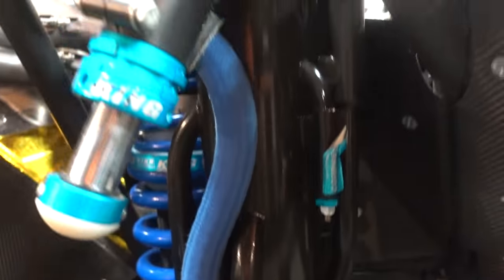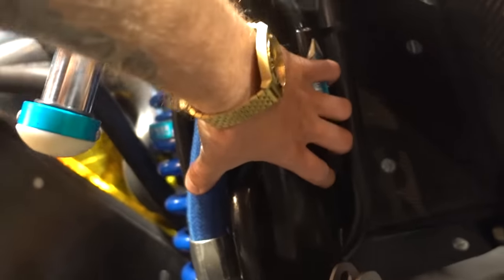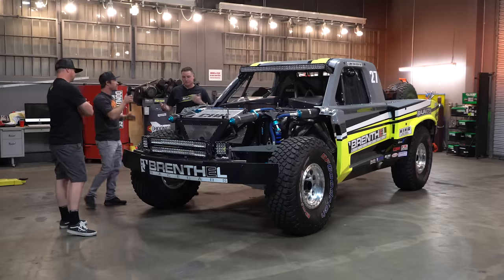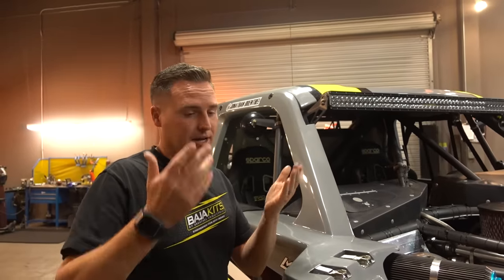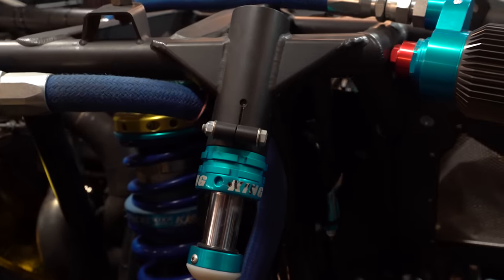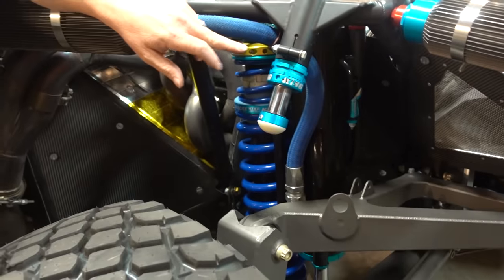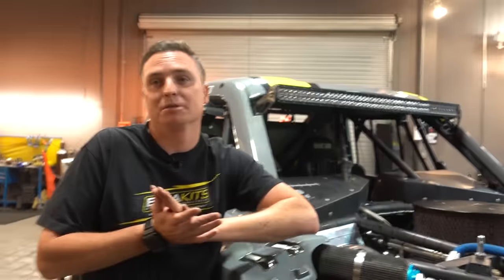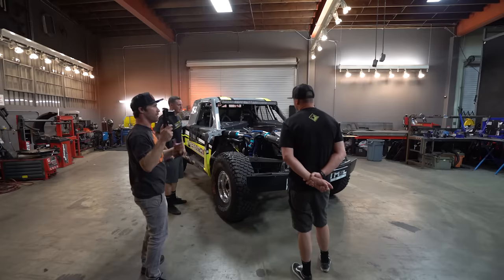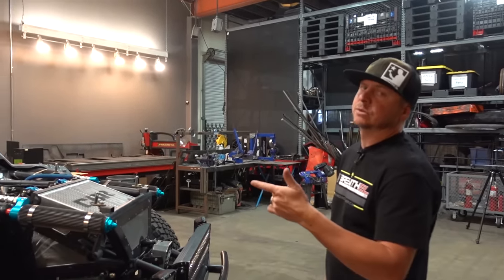It's a secondary shock — a 4.5-inch diameter King shock. It's position-sensitive, so these tubes have screws and adjusters on them for compression and rebound. What those do is let the wheels go up and down at different speeds depending on what kind of holes you're going to hit. It's a secondary hydraulic bump stop that contacts the arm at the last bit of travel — it just helps the suspension compress on big hits. We have 26 inches of travel in the front and 32 inches of travel in the rear.